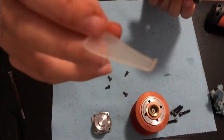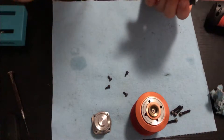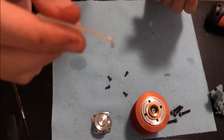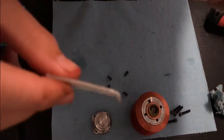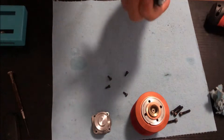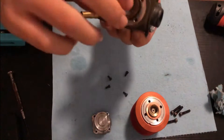I have this little piece of plastic from like a tackle box divider. I just bent the end of it like that, so it hooks into the exhaust port, and when you turn it over the piston comes right out.